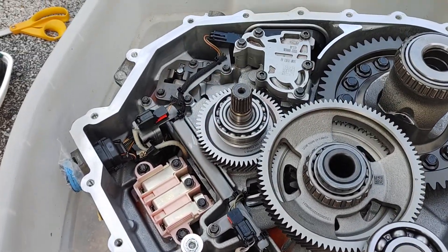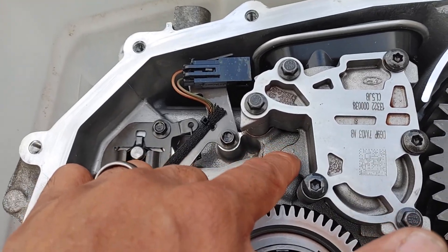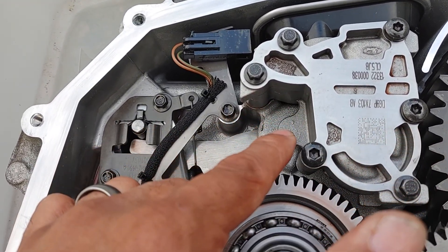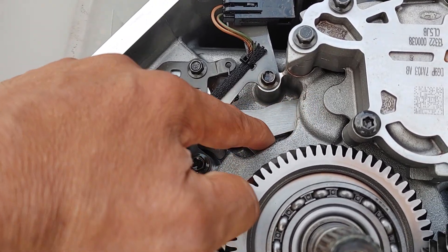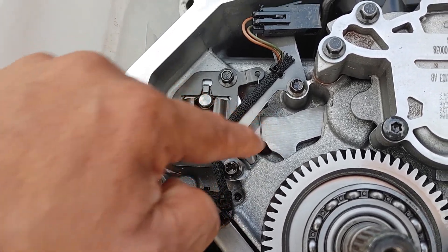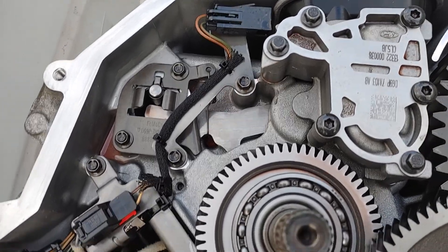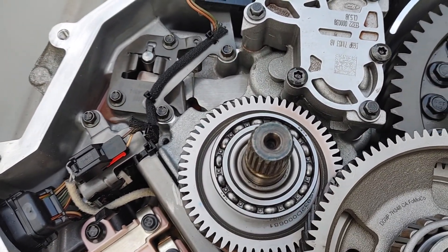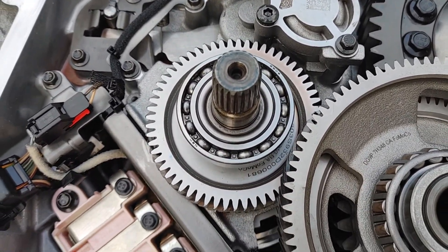I replaced the filter. When I replaced it, there's actually a rest pin right about here. I pulled the rest pin up and this component changed its alignment so the rest pin couldn't go back down. All you have to do is move this piece over — you can move it by hand — and it'll allow that pin to go back down where it's supposed to go. You want to check your pump gear to make sure it spins properly with the rest of the gears as they spin.